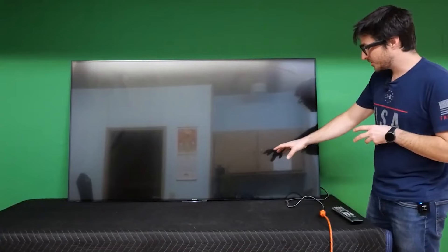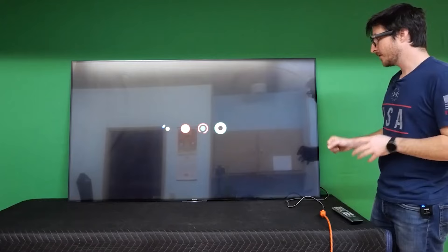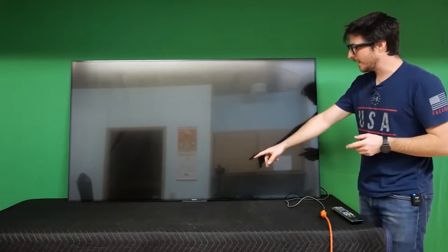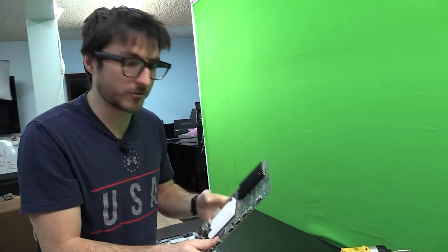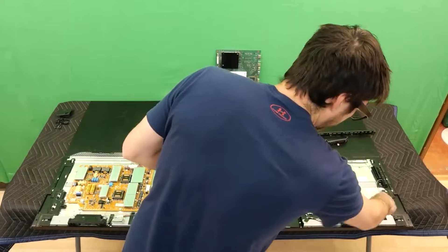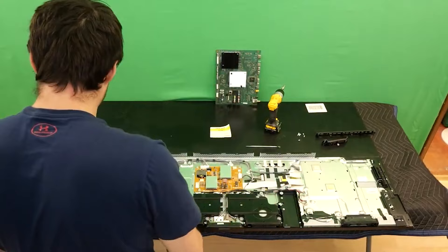The TV was just turned on. At first the picture looks okay, but with this model specifically, the bottom left corner starts going dim after a few seconds. Then a few seconds later we get some intermittent blinking, eventually shutting off with a 4 or 6 blink error code. We've already done a video on opening the back cover. We've removed the main board and our next step is removing speakers and other accessories on top of the silver shield — the LED strips are behind it, between the screen and the silver shield.